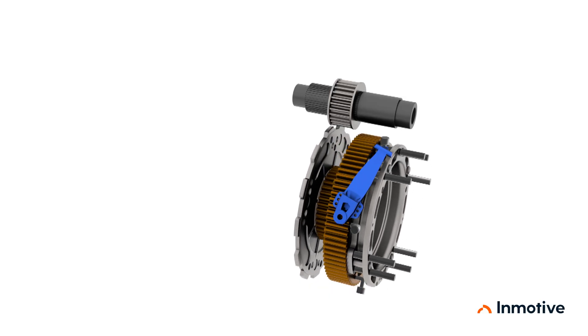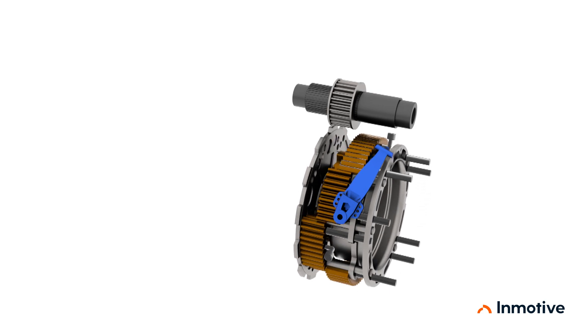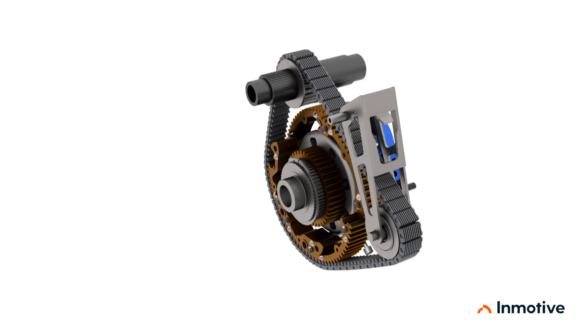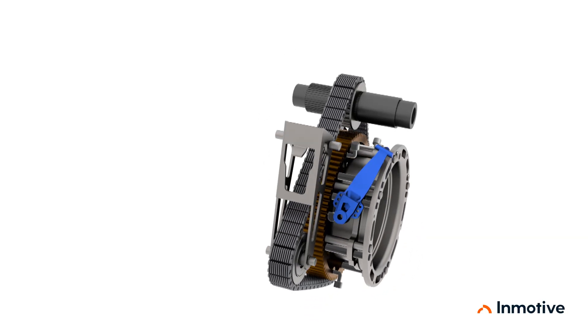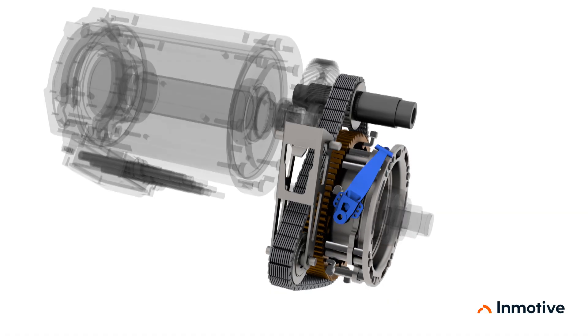Now, let's shift from high gear back into low gear. Whether up-shifting or down-shifting, the in-gear keeps the motor continuously connected to the wheels, allowing uninterrupted control of torque. Once a shift is complete, the in-gear operates on perfectly round sprockets, which are as quiet and robust as the chain drives found in millions of cars today.